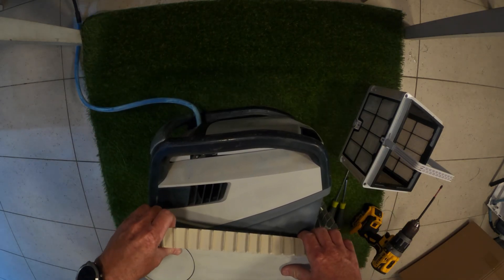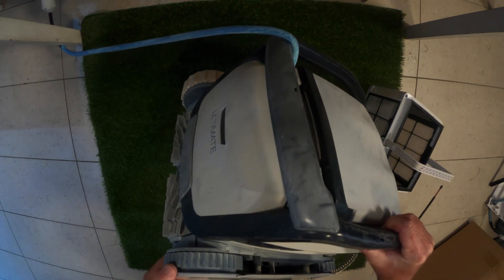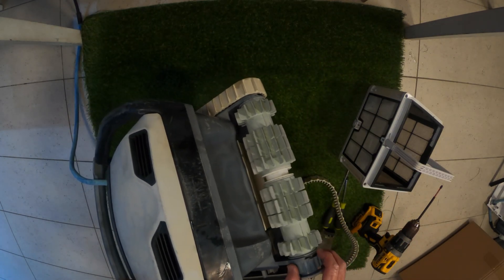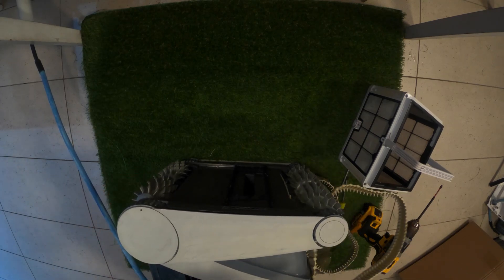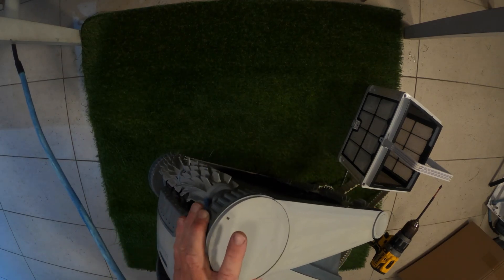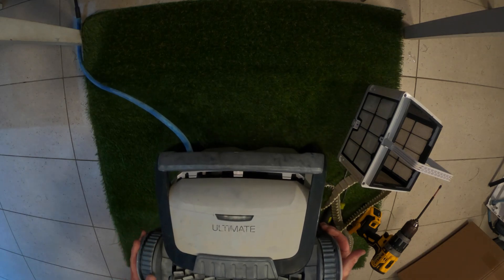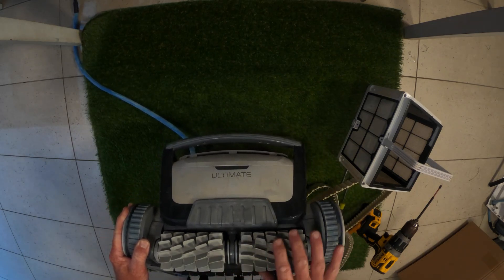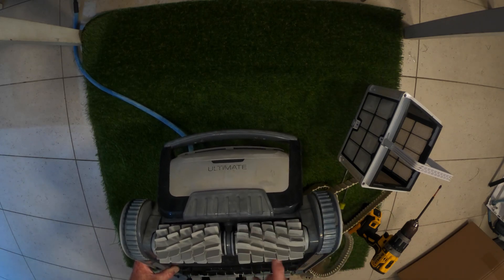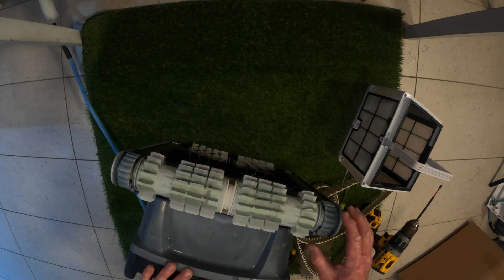You also want to check if there's anything caught in the tracks. You can easily lift the track off and see if there's anything caught down in the wheels. Same on the other side — it should be able to spin fairly freely with no resistance. Check the brushes to see how they're worn. Sometimes the brush support collapses and needs to be replaced — we'll have a look at how to check and replace those in a moment.